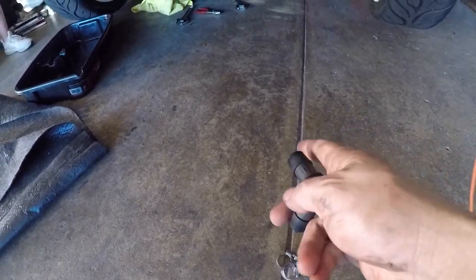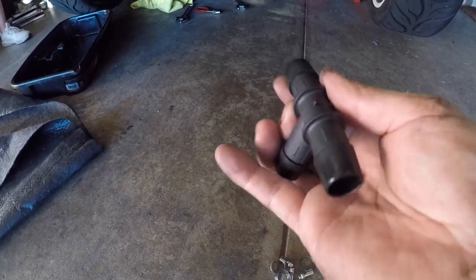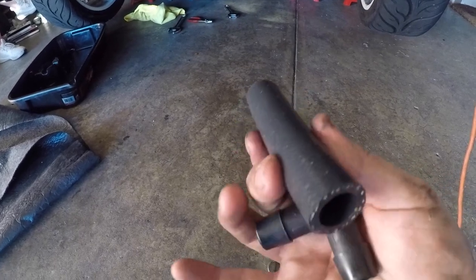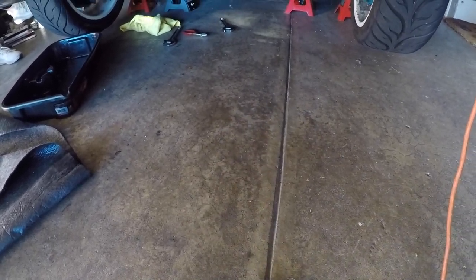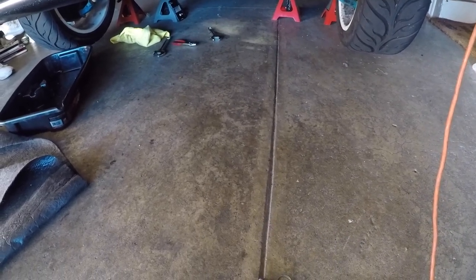And I'm gonna cut 1 inch off the hose. So if you're coming from the firewall, the order is gonna be the regular hose, cut 1 inch off, T connector, then the rest of this going onto the black hose, and then of course the bottom one's going to be the cooling mod. All right, so I have a pretty good angle. You're going to be able to see everything, and I'll show you a finished product when it's done.